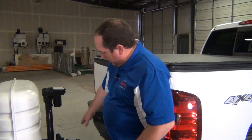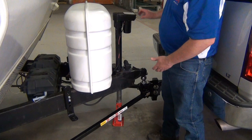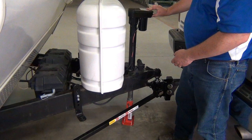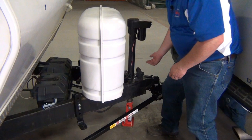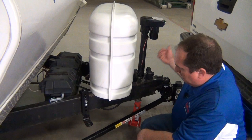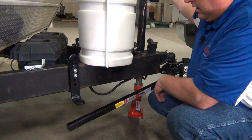Now let's go through the process of hitching up, which is essentially the same as unhitching the trailer but the steps are done in reverse. Say we're ready to take it out for our first camping trip, we've got it all loaded. We back the truck up, make sure that we get the hitch ball underneath the coupler and we've got our spring arms in place. Now we're just going to lower the weight of the tongue down onto the hitch ball far enough that we can couple the trailer latch. We engage the coupler latch and now we're going to raise both the tongue of the trailer and the tow vehicle. What we're trying to do is accomplish the distance between the end of the spring arm and the top of the L bracket — that's the distance that determines the amount of weight distribution you're getting out of the hitch. So we'll simply leave it coupled and use the tongue jack to do the work for us.